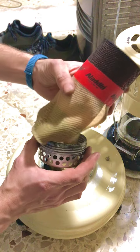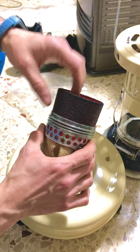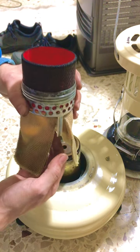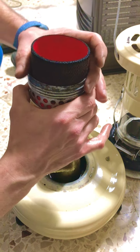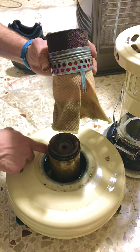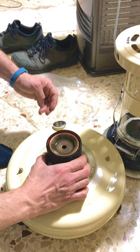Simply put the wick in like this. When installing the wick, you have to make sure that this tag sits in between the wick, because there's a recess inside the tank that keeps this thing stationary. When you turn the whole thing, this keeps stationary and the wick goes up. There's a slot — the camera is fixed so I can't show it directly — but this tag has to go inside that slot. It's very simple; you just have to make sure everything is properly aligned.